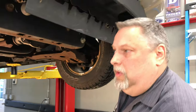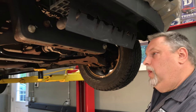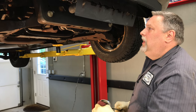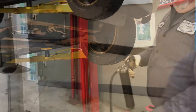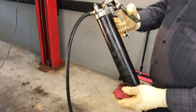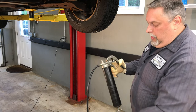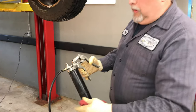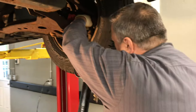When you do your oil change, you want to check your tire pressures, lubricate all your door hinges, check all your fluids, and check all the lights every time. It's good to just get in the habit of doing that if you're going to do your own oil change at your house — it's all part of the service. You want to make sure everything is up to snuff when you get going down the road. You want to get a grease gun like this — they have grease cartridges that go in there and they're great to have at the house. You can use it on a riding lawn mower or your car. These are about 24 bucks for a nice grease gun. They also have a miniature version, but I find those run out of grease too quickly. You can pick them up at any local auto parts store.